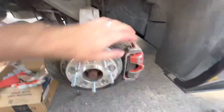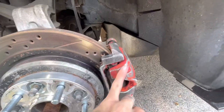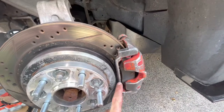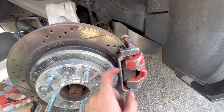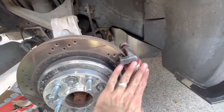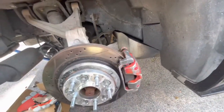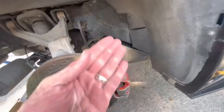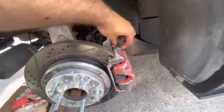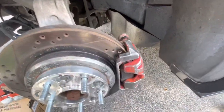So here you'll see we're done with the wire brush, and then I went over it with sandpaper. I wanted to make sure I got all the old paint on the raised edges as smooth as possible. You don't want part of it rough and flaking and part of it smooth, because when you brush on and build layers you might see that underneath. I went over it about three times with brake cleaner as well as a wire brush to get all the contaminants off. Then I'm going to tape up the two little piston boots right here and we'll get to painting.